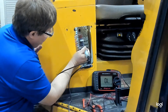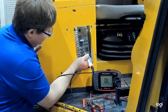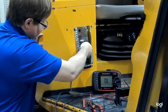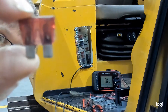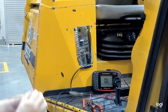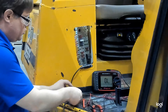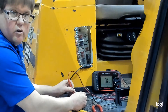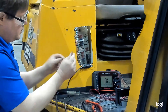If you have power on one side but not the other, that is an indication of a bad fuse. Here we have power on the right-hand side, but when I go to the left there is no power — that is an indication that this fuse is bad. We'll pull that out. A lot of times people feel they can inspect the fuse by looking at the filament inside. You'll notice that filament looks okay. Many fuses that blow will have a destroyed filament that you can visually see, but that's not 100%. This fuse just tested bad — let's test it with our ohmmeter. One lead on each side, and you can see we're still out of limits. We have no continuity, there's no beep. This indeed is a bad fuse; this 10 amp fuse would need to be replaced.